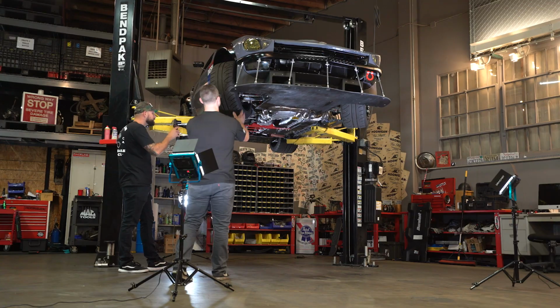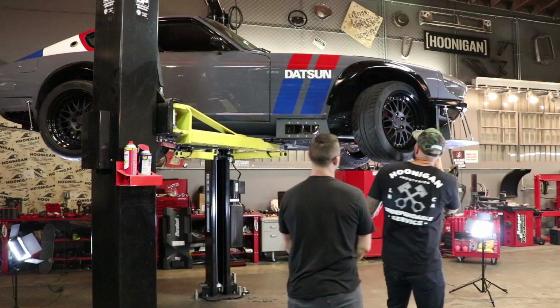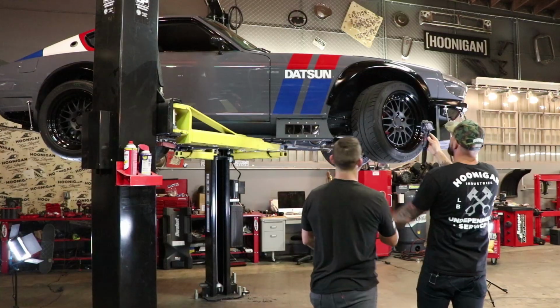So I've drilled and ported in and then machined the heads of these to accept my adjusters. And so you come out here and, you know, just click, click, click. You can actually reach around the wheel without pulling the wheel or anything at the track and just make an adjustment. So it's a stock spindle sectioned to the coilover tubes, and then it's a Wilwood front hub system with the 5-lug conversion, and then the 12.2-inch Wilwood brakes.